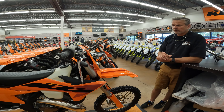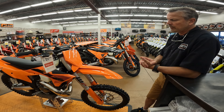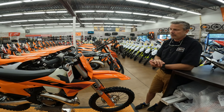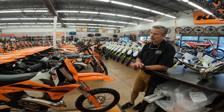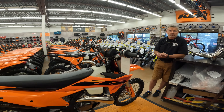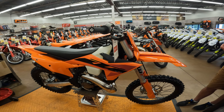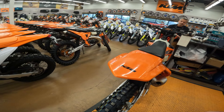For those looking for an XC, this is definitely a different bike. This is for someone who's going to really ride a combination of tight and twisty as well as a little bit of open country. Especially with the popularity now of the 300 SX or the new TC 300 in the Husky lineup — I've got folks who like to get on a track now and again. They say give me an enduro two-stroke that I can take to the track. With its long travel linkage suspension, closed cartridge fork, and just that grunt to hit a double, this bike pulls a lot of double duty. I know guys who have 23s and 24s that ride strictly hard enduro on them with no complaints — they've worked some different things out with stators and fans to make that happen.